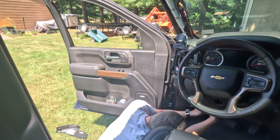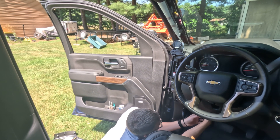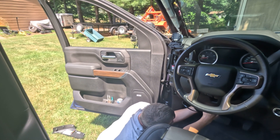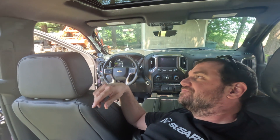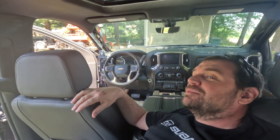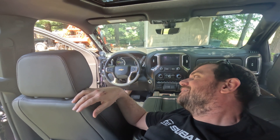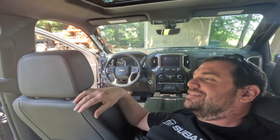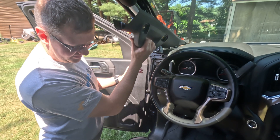One of the early times I was driving it I didn't know what it was doing — I turned the truck off and thought, 'Why does it smell like burning plastic?' I hit up buddy Jeremy in Pennsylvania and he told me it was the regen. I'd also want that for the van to know when fuel pressure drops, but a 1988 van has no OBD at all — not even OBD1.